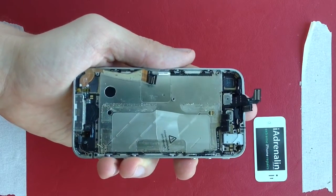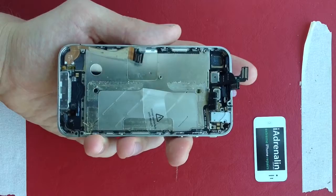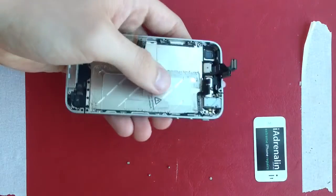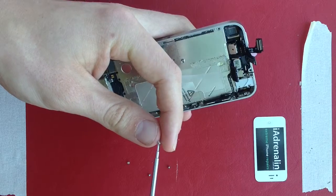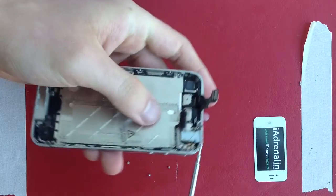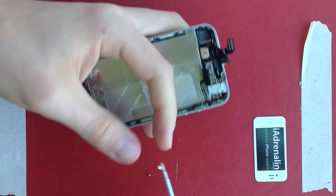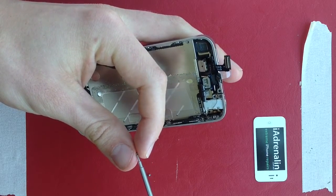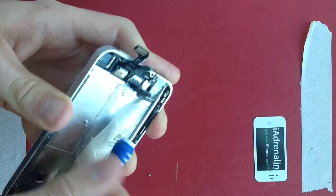The first thing you want to do is take the four outside screws that go here, here, here, and here, and reinsert those. If you have a cheap screwdriver, which comes with most repair kits, this can be quite painful during the reassembly process, because they don't have much magnetism in the screwdrivers themselves. What you can do is get a strong magnet and run your screwdriver over it — that will help remagnetize the surface and make it much easier to do these screws, particularly these screen screws.